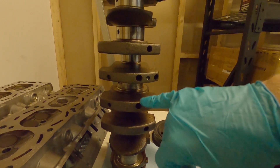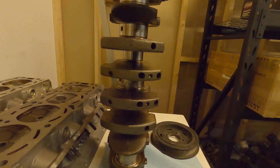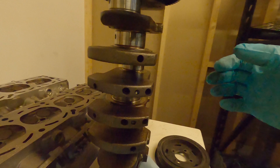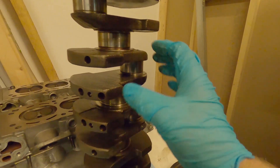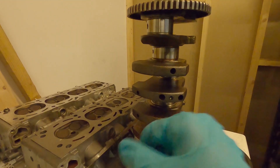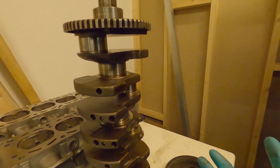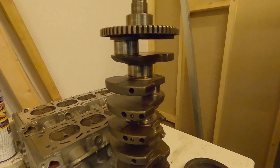If you look closely at the crank you can see there are various holes drilled in there to act as a balancing adjustment, to counteract the mass on this side of the crank. If there's a vibration you need to modify it — either shave material off or put small drill holes in here. Normally cranks are designed with extra material so you're always removing material from the counterweights.